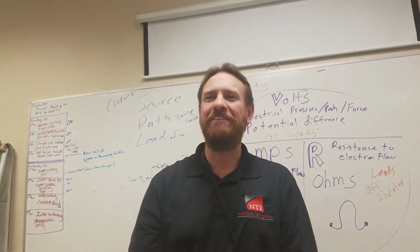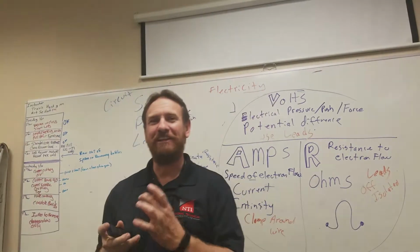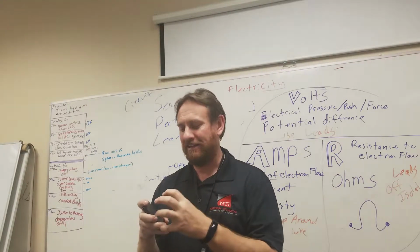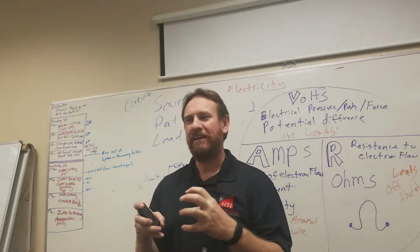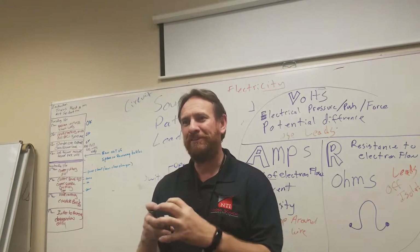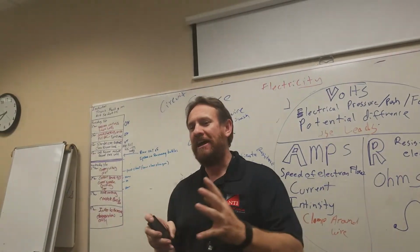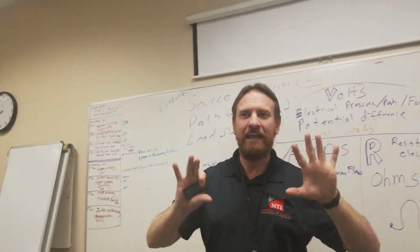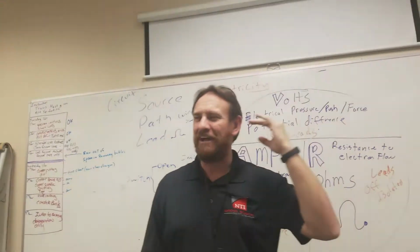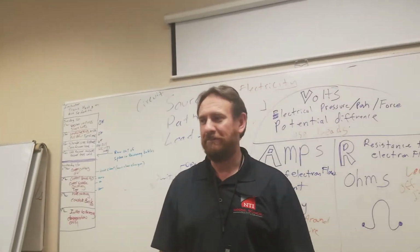And what else does the speaker have in it? A magnet. Right? So now you have an electromagnet and you have a magnet, and we send the pulse in. The electromagnet then wants to push away, and come back, and you send the pulses at different amounts. You make different movements, different frequencies, and that's moving the air. Molecules are bouncing off the air, which makes different sounds, our ear picks it up, and we hear that as being, in some cases, music.